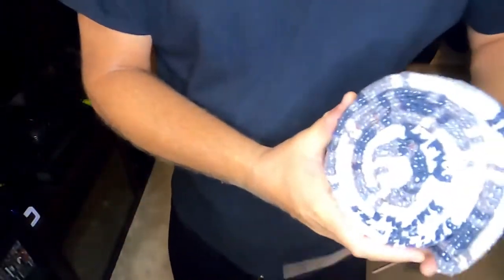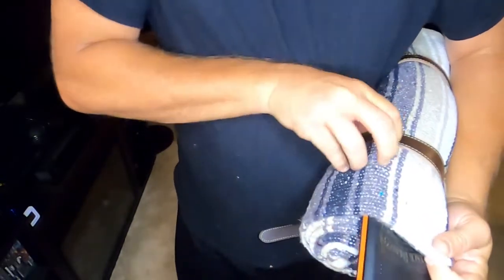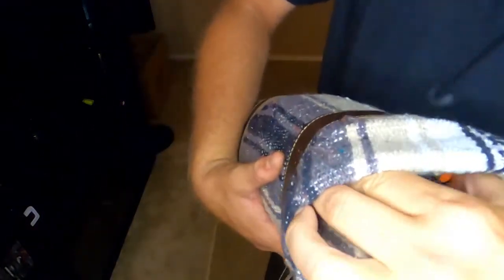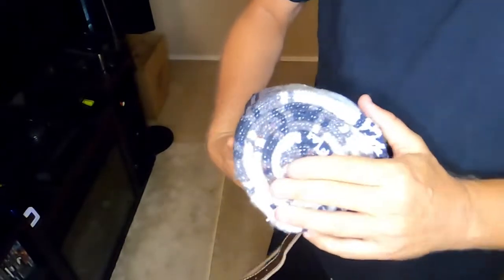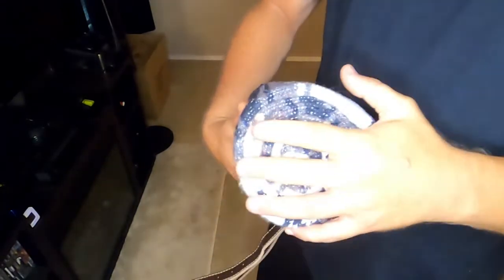This is how I particularly use mine: I've got a battery pack — which is charging my GoPro and my light right now — and I'll just slide it in underneath the bedroll. Then I'll take whatever cables I need and run them right through here, underneath and up to the charger for my cell phone or GoPro, depending on what I need charged. That's a little tip for those of you who film or have a cell phone. I don't like charging the phone off the bike due to its electrical system — I don't want to burn out the stator or regulator.